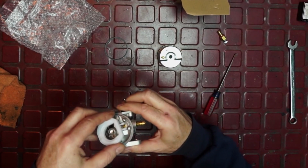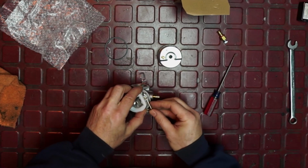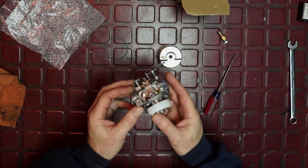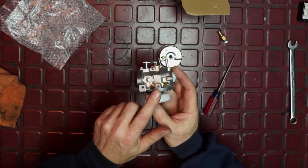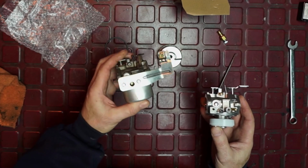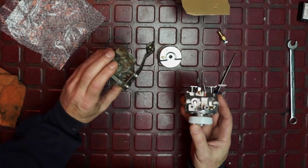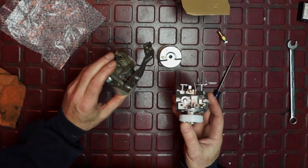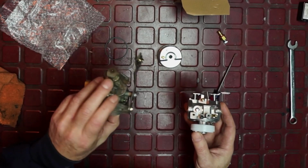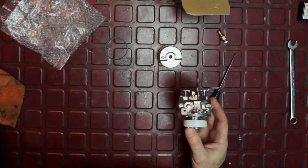Well, the construction of the carburetor is very good. And one last thing. So again, this is Tecumseh. I'll switch to the other camera. And it does have the mounting bosses here that are drilled and tapped. And that's for bracketry, like that, okay? Or sometimes also in snowblowers, it holds the front cover assembly on. It's what's known as the air box. Very important. In this case here, that's just a choke adapter bracket that runs the chokes and holds the cable.